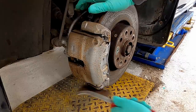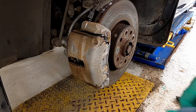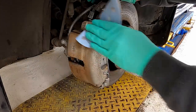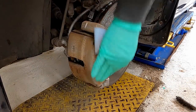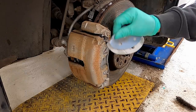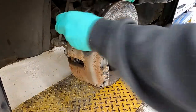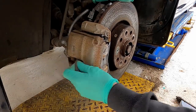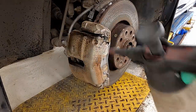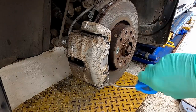I'm going to be honest - the brake calipers weren't something which was being budgeted for, so I'm doing this off my own back because I think it looks awful and it just needs tidying up. This is not a concours job - if you wanted it absolutely perfect you would remove the caliper completely and have it shot blasted and powder coated. But today I'm just going to tidy up this poor repair as best I can. I've used a wire brush initially to get any loose surface paint off, then gone to a 240-grit sanding disc to scuff the surface up. Once that's done I switch to a scotch pad which is a micro abrasive, and then I use some brake and clutch cleaner to spray over the surface - it cleans the area and gives the paint a nice area to sit on by removing any debris, oils and grease.